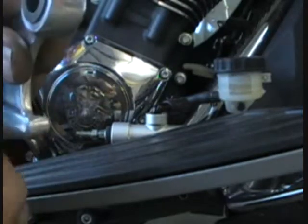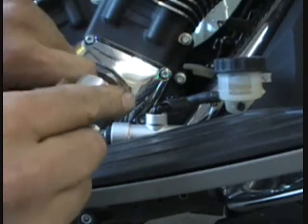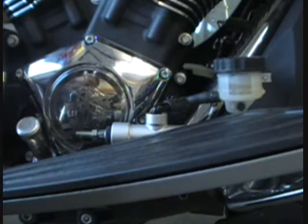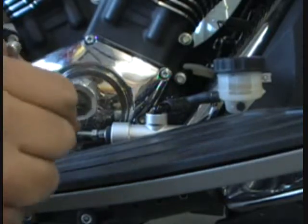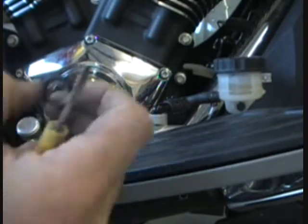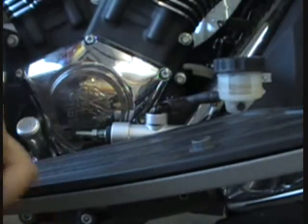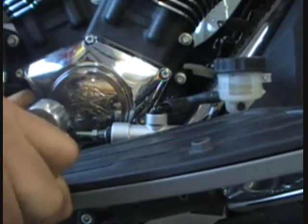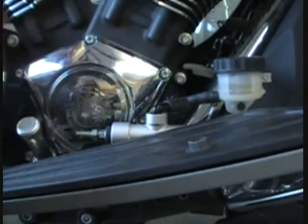Set that stuff aside. Now the other little bit of a tricky thing is these bushings in here. Sometimes they come right out, sometimes you got to pound them out. You want to try to be careful not to damage them if you're going to reuse them. I just take my little screwdriver and just push it, doing it evenly — push a little at the top and a little at the bottom and the bushings will come right out. Flip it over and make sure you don't push like this because you will stab yourself in the hand — don't ask how I know that. Just push and you can see it came right out.